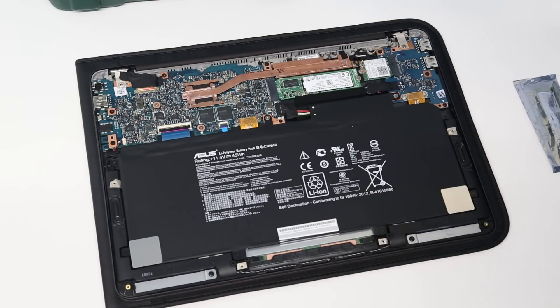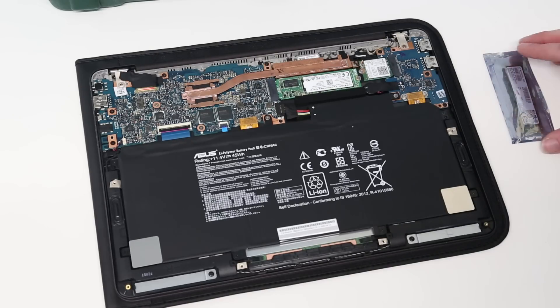I'll put an annotation for how to create a UEFI bootable Windows install stick, and also how to install from that. I hope you found this video useful, and learn from my mistakes: this laptop cannot take an NVMe M.2 drive — it is only SATA. Thanks for watching.